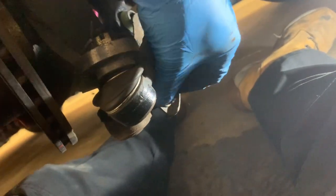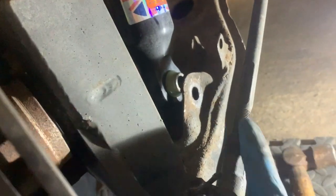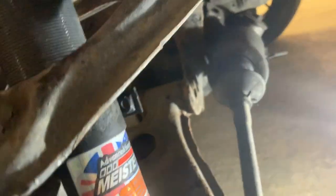This little bolt here goes straight through your bottom ball joint — 19mm. Get yourself a spanner on one side and buzz it off the other side with a socket or another spanner. Ratchet spanners are wicked for this. One undone, two undone, three undone, four undone.